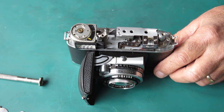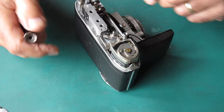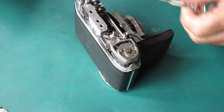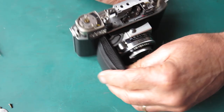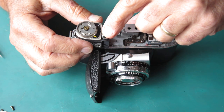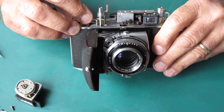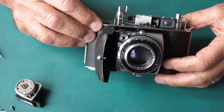We're not disturbing the meter at this stage - it can stay exactly where it is. However, I will remove it now because it makes it easier to see what I'm doing. There's a single screw at this end, and I can see that plastic piece is already broken - instead of being a closed loop, it's just like the letter C. I'm holding my finger on the shutter release while I lift the meter away, because I don't want to lift the shutter release out of the camera - if you do that, chances are you'll end up with grief.